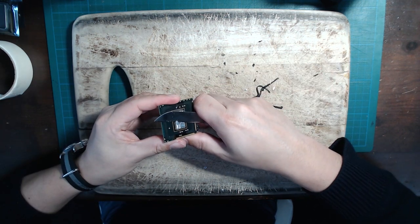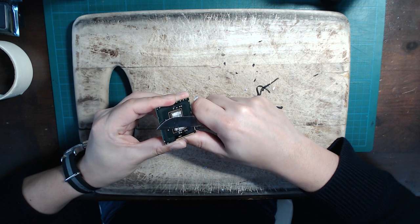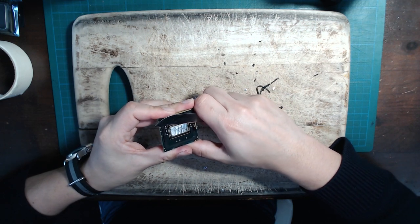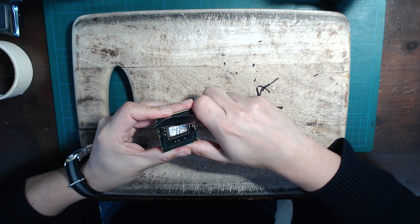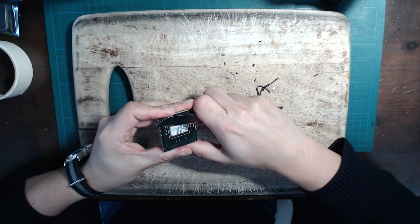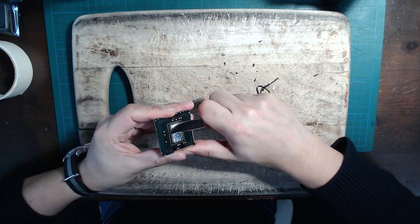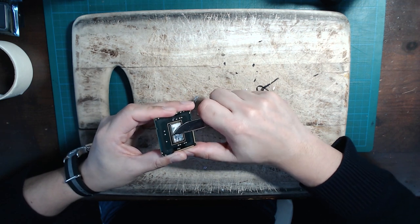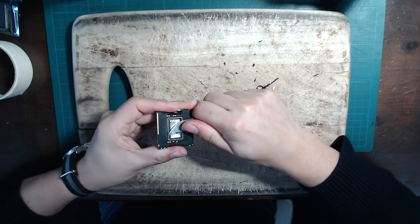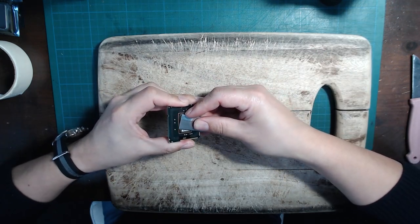There are different methods for removing the leftover solder from the CPU. I just used a knife, I've used the single edge blades, and I've used a little bit of sandpaper, I think it was 600 grit. And the sandpaper made it a bit easier to get a feeling where I could or had to remove some solder that was left on the CPU. To be totally honest, I don't think you need to or are able to remove all the solder. Just make it a nice smooth surface. The thermal paste that we will use between the CPU and the heatsink later on will smooth it out nicely, I think.